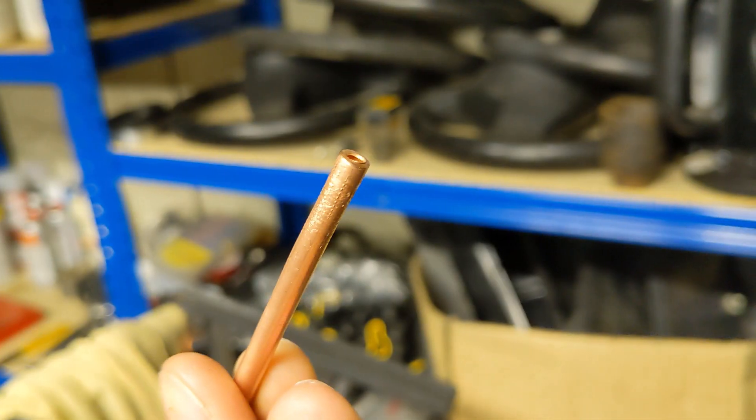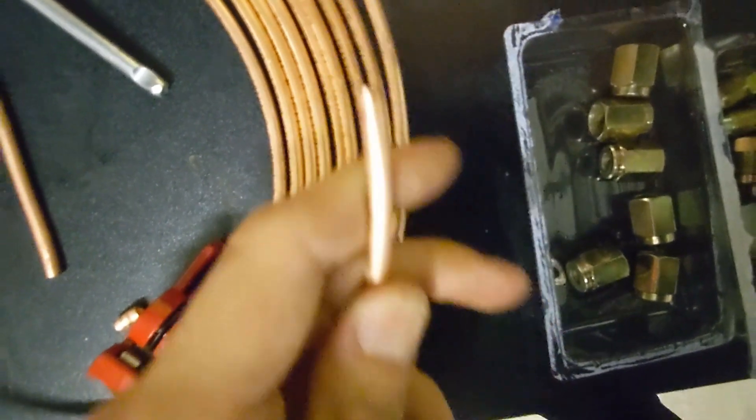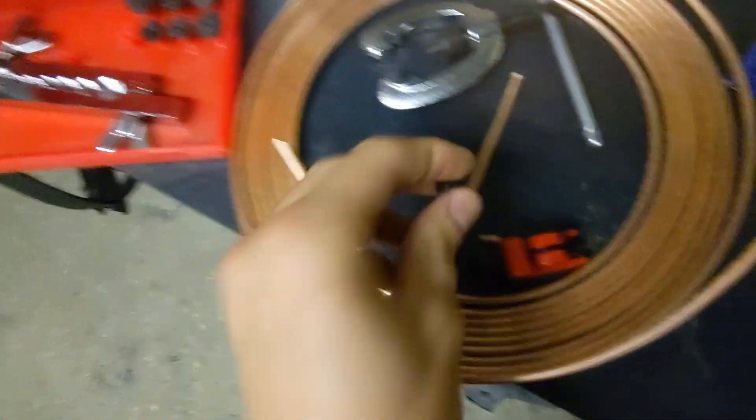If you look at the other side of my brake line, this is the failed attempt where it just goes sideways and flops over and doesn't do anything. That is really the main issue with this tool — the nipple thing doesn't stay in the line properly, so it falls over and snaps. The tip is to not deburr the line after you cut it, so that the opening stays tight enough for the thing not to flop over. It works! But Harry said I don't have the right fittings — one of them is M12 and one is M10. I'm an idiot, but I'm learning.